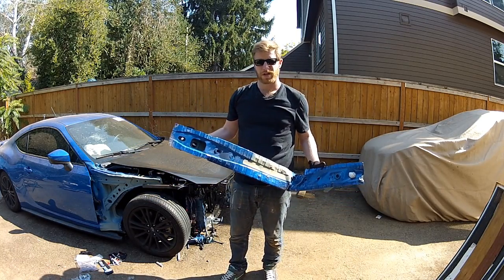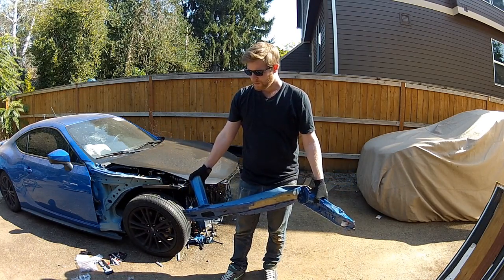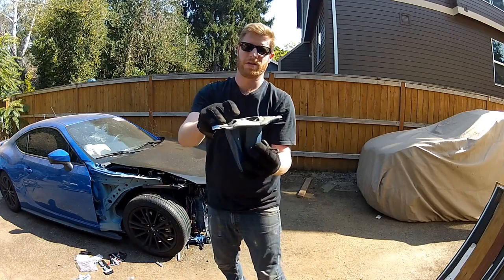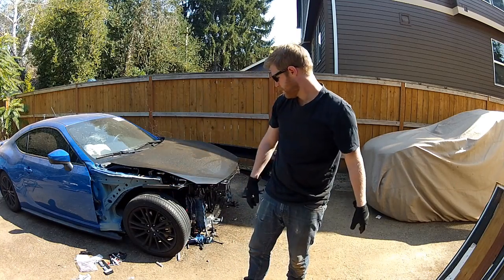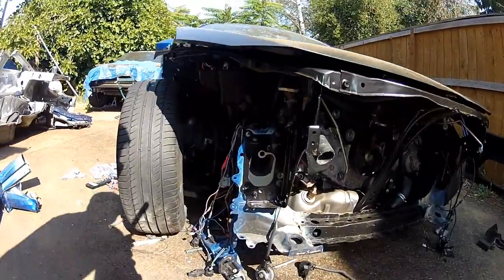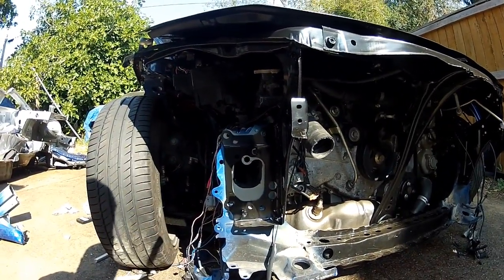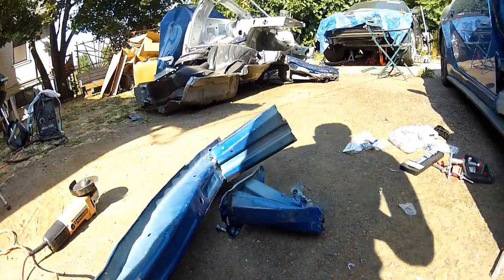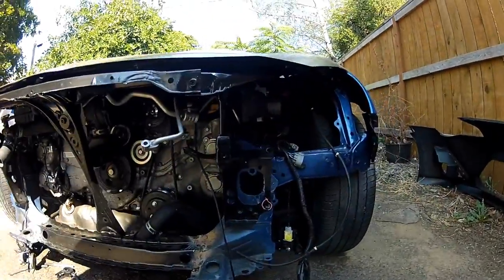I'm going to be doing a quick DIY on the cheap — how to rebuild one of those for your car. I'm going to be using the feet off of this mangled one. I'm going to be grinding the feet off to match up with the frame. One of the biggest issues I found when trying to create an impact bar was I couldn't find metal at the hardware store that matched up for this footprint very easily. So I'm repurposing the feet off of my mangled one, grinding them off and flattening them so I know they'll match up on all the holes correctly. Then I'll weld bars in the middle to support it.